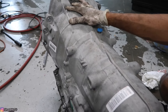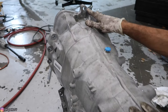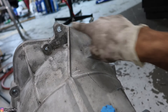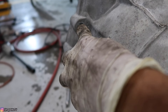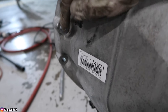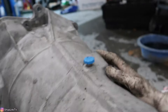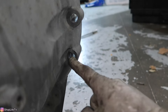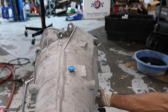Here's the replacement transmission going in — I'll show you where all the bolts are and the sizes. At the very top you have two E14 bolts (external Torx 14). Then there's one that goes to the starter — external Torx 12. Then there's an external Torx 18 bolt on each side. There's also an E10 that goes to the oil pan. On the other side: E14 at the top, two E18 bolts, and two more E10 bolts at the bottom that also go to the oil pan.